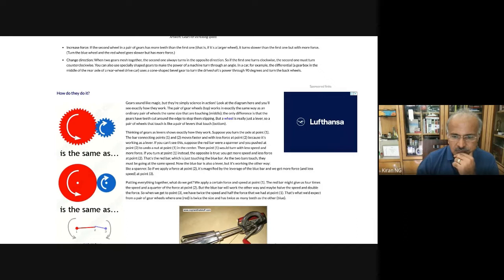Okay. So similarly, second, third gear will gradually increase the speed of the vehicle. But the RPM of the engine is higher at lower gear because you are also giving more accelerator. You are giving more power. At higher speed, even though speed is higher, your effort is low. Don't worry, you will understand there are a lot of things in motion. Then you have to also study about momentum. Once you pick up the speed, you need lesser effort to maintain the speed than at the starting. So you will need higher torque at the beginning.